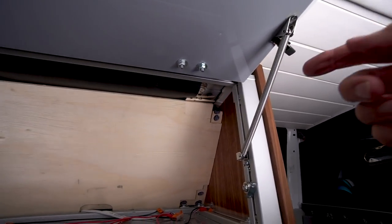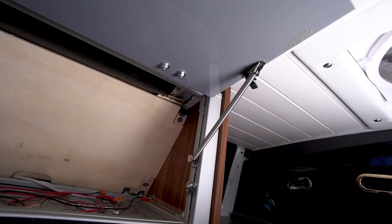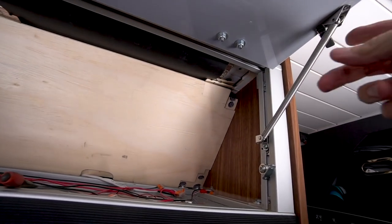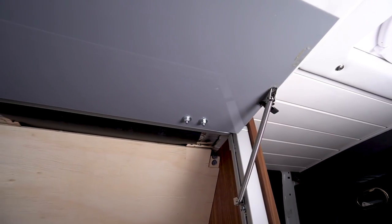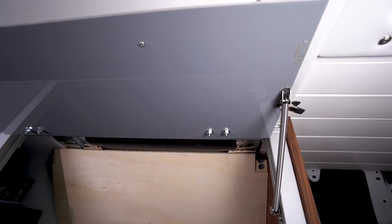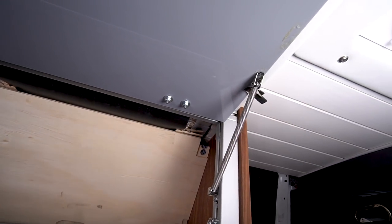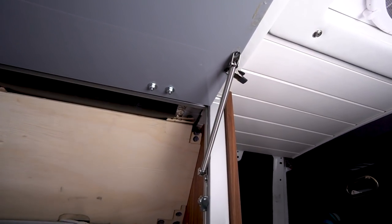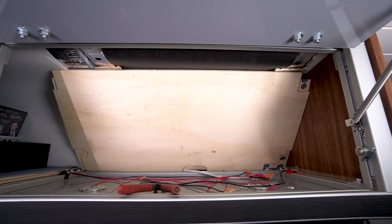The spring lifts proved to be an excellent, excellent feature for these doors. The problem is we glued them to the plexi, the acrylic, from the underside, because we didn't want the holes and screws showing on the front side. Well, they all broke. All the glue let loose, so we're going to have to go in now and screw it in. I'm not going to re-glue it. That's the definition of insanity.